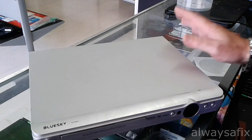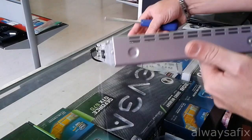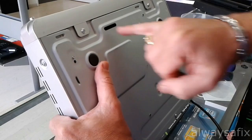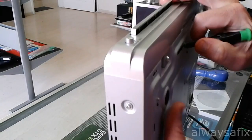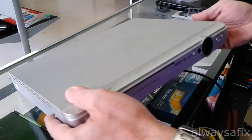There are a couple of screws around the back and the sides. Take note that when you remove the screws you could be breaking a seal that would void your warranty, so if it's under warranty just take it back. If you have a DVD stuck in the machine and you just need to open it, some players have a slot underneath where you can just slide it and it will actually just manually eject the tray. So if you just need to get the tray out maybe to return the DVD to the rental store, you can access it that way.